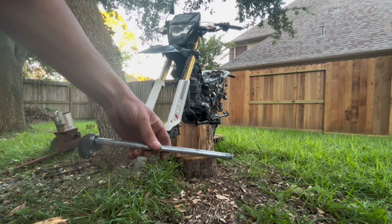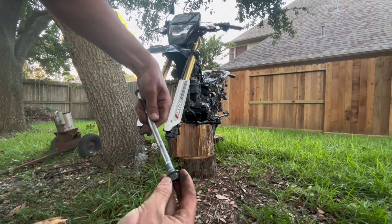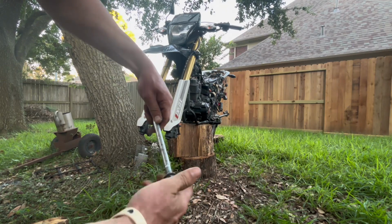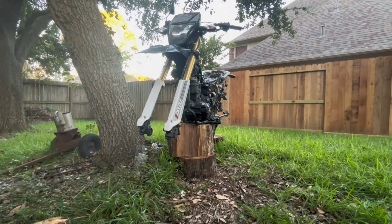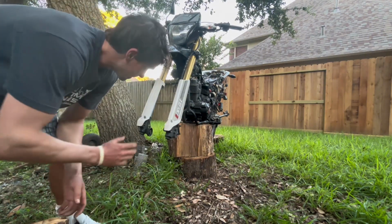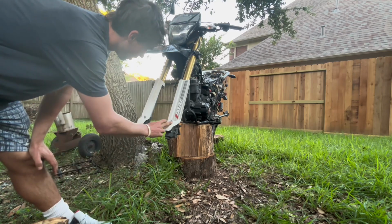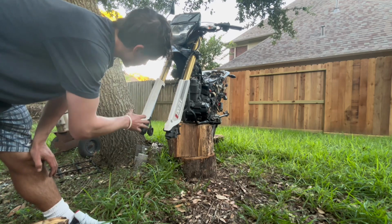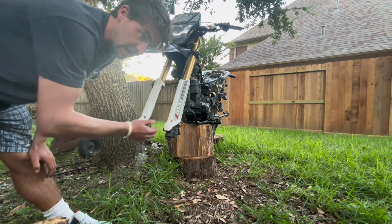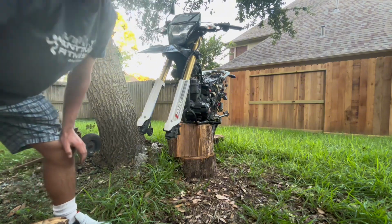After you take this off, so you don't lose everything, put these two back together, mate these back together before you walk away. Perfect, now I'm not going to lose it. Okay, now, for the triple trees to come off, everything has to come off, including guards, brakes, speed sensor. Everything has to come apart, or at least be dangling out of the way. So we're gonna go ahead and start taking these little itty bitty things off.